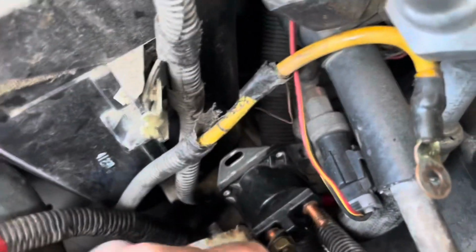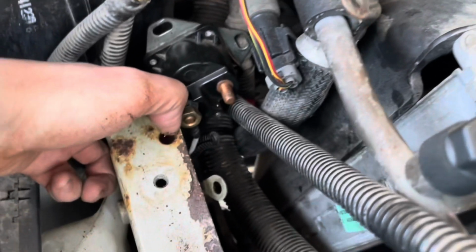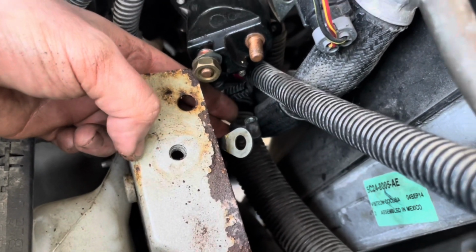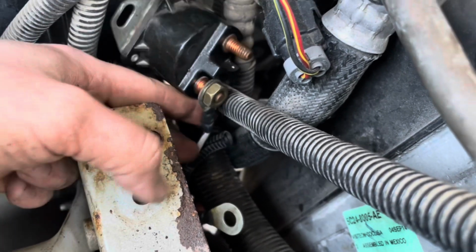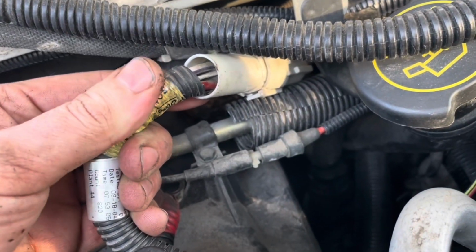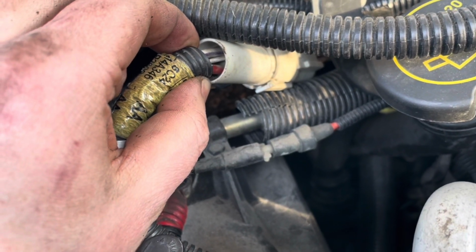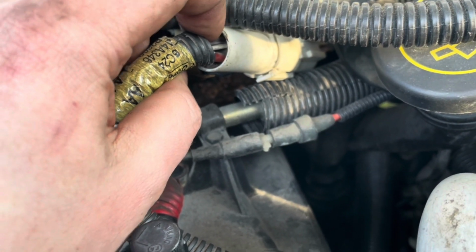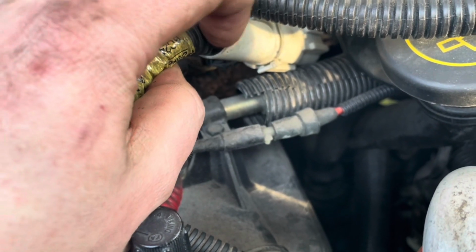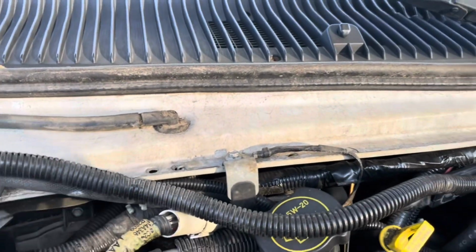And there is, let's see, plucked off this little nub. This is a white and violet wire. This wire here is a violet and white. It matches the book. It goes to this lug. This connector here is solely for that circuit. Red and yellow transports power over to the fuse box for taillights. White and purple is 60 amp. Charges it up. And then the little white and purple wire is a control. It turns the relay on.